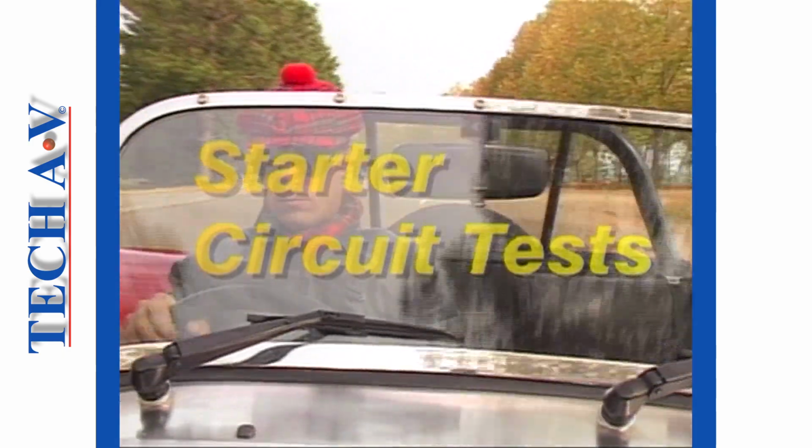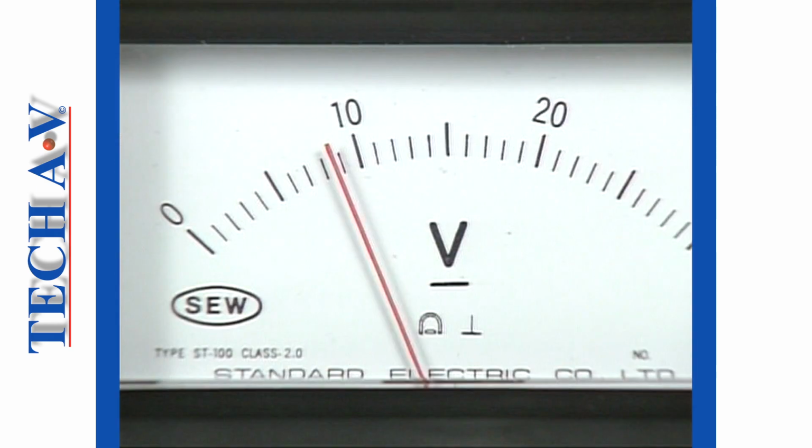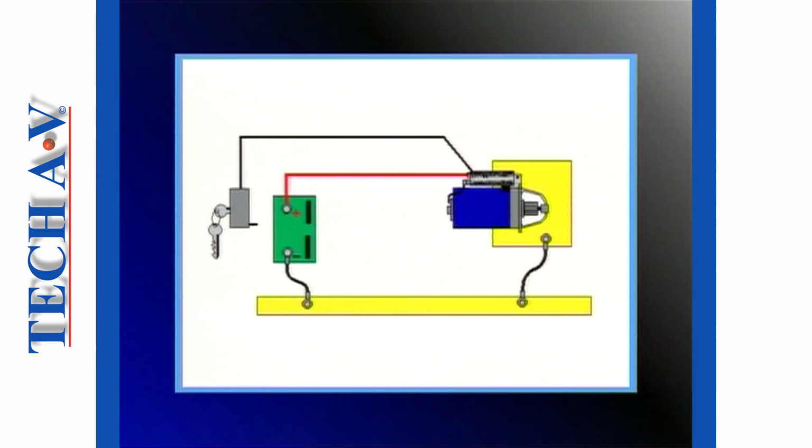Welcome back as we continue with starter circuit testing. Based on the assumption that we read a voltage lower than battery voltage at the starter main terminal, it means that there could be an excessive resistance either in the insulated line or in the return line.